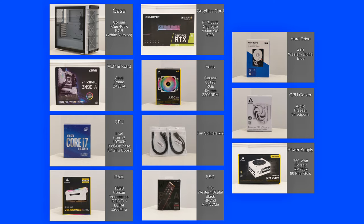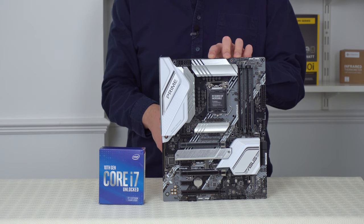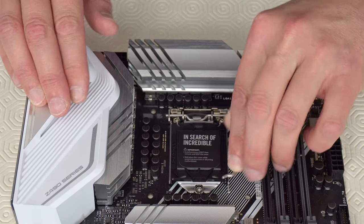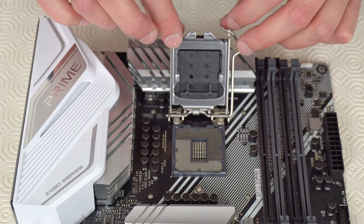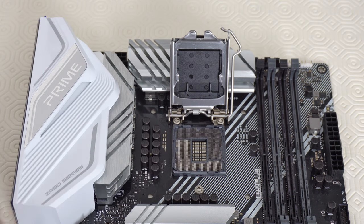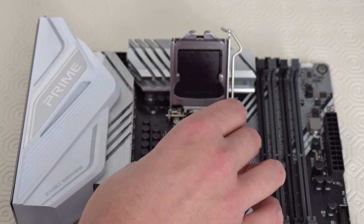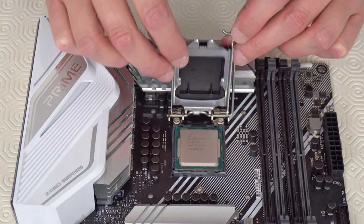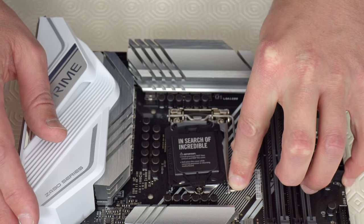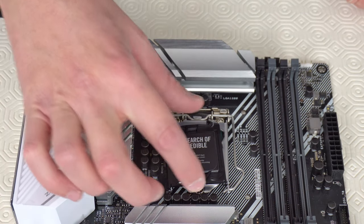So here's all the parts at a glance. I'll be showing you how to build this computer but I won't be going into such minute detail as I normally do, so this will be more like a quick guide for a change. So let's make a start by putting the processor into the motherboard. We're going to be installing the processor into the motherboard just here. So just lift up this arm and the lid, then line up the small triangle on the processor with the dot on the motherboard, and put down the lid and the processor arm.